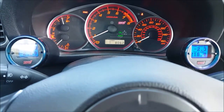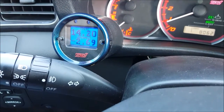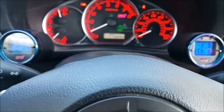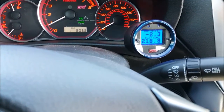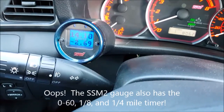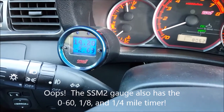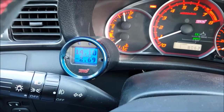If you do buy a dual set — which I have in this car — the second gauge will be our original CAN bus gauge, because you can't run two devices using SSM2 at the same time. The CAN bus gauge has a limited number of parameters, but it does read and clear trouble codes and has the 0-60, eighth, and quarter mile timers, which the SSM2 gauge does not. The main advantage of this new SSM2 format is access to a lot more parameters — specific things guys want to see when tuning and monitoring the car's performance.